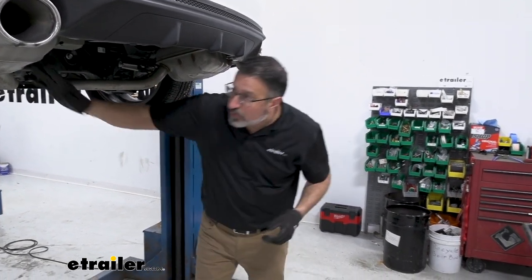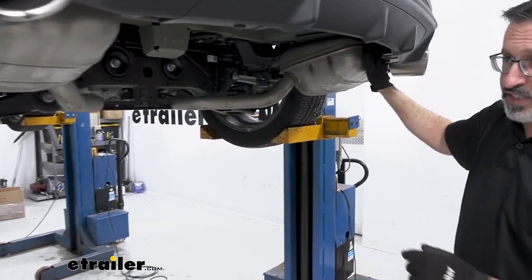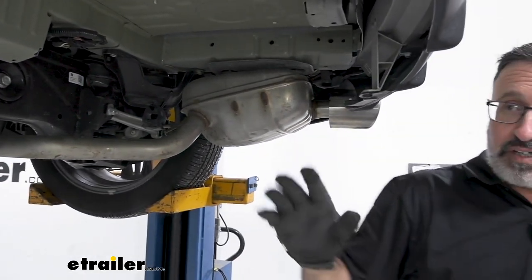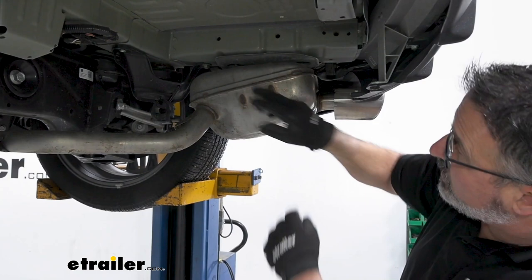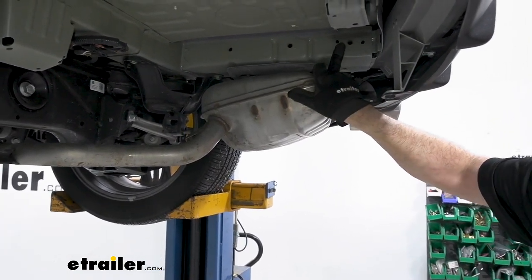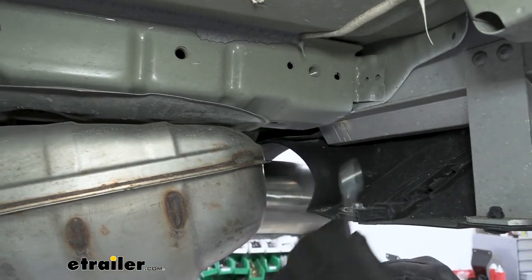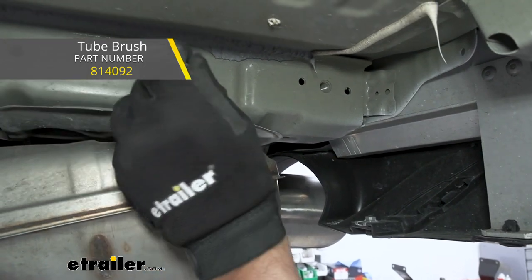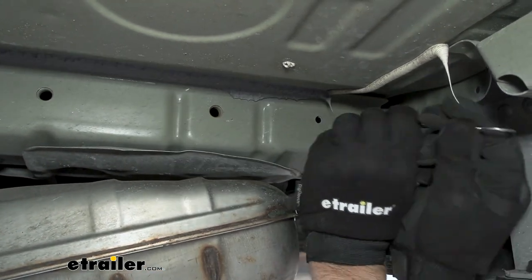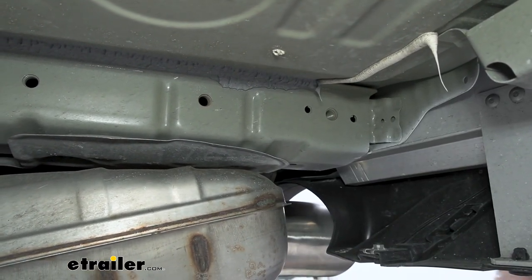The directions tell us to lower the exhaust — there are four exhaust isolators we'd need to get down. However, we test fit it earlier and found we don't even have to remove the exhaust to get the hitch up here. It's going to bolt right up — there are four bolts here and here, and the same on the other side. Since these are already threaded holes that have been exposed to the elements, I've got a little bottle brush to run in here and clean the threads out. That'll make it easier to thread your bolts in while you're holding the hitch. Go ahead and do that on both sides.